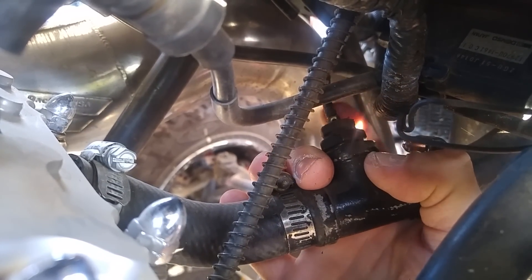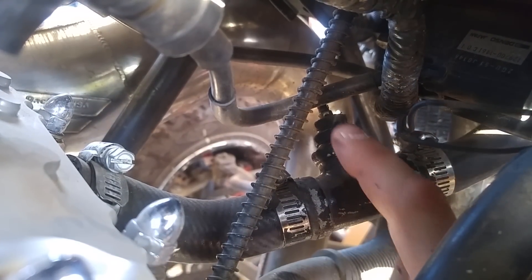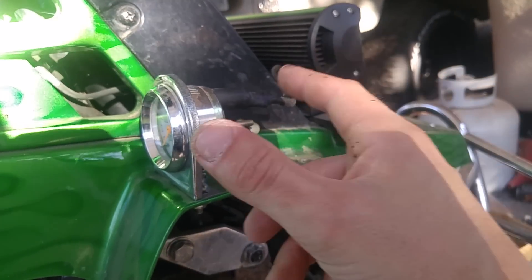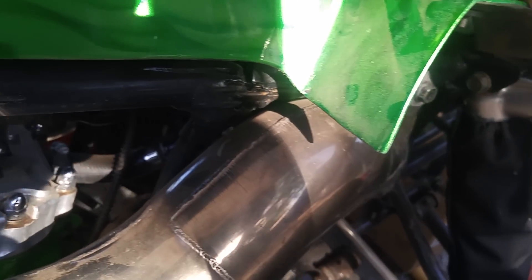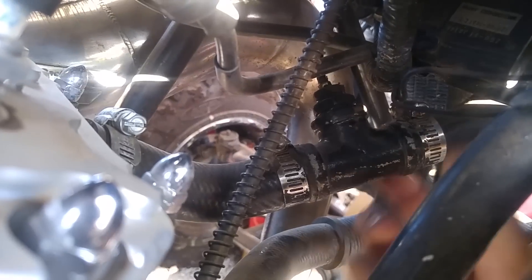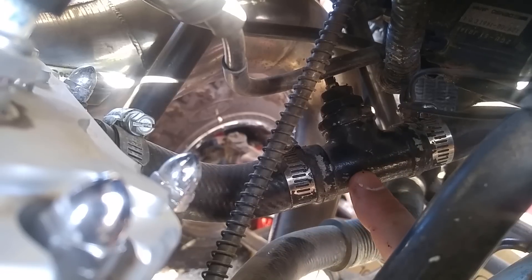This is the line that comes in from the temp gauge — the one I have my pointer finger on right now — with a copper piece inside of it. Inside that piece that screws on there is a little copper probe that goes down in, picks up the temperature, and feeds it out to the temp gauge up on the dash. That's how it works. I basically screwed it right down there. If you want power for the bulb, you could run a 12-volt connection — it's got one copper wire lead that I insulated with some silicone hose so it wouldn't vibrate or crack. Down here you can see the three-way tee hooked up to the radiator hose with a connection for the copper probe.